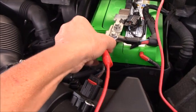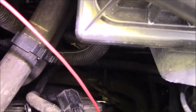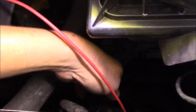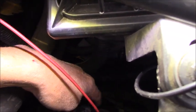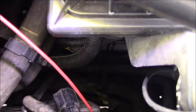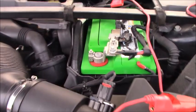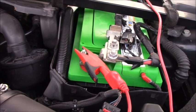See, as you can see, it's running right now. That's it guys — quick test. The radiator fan module has no connection to the engine control module because I left the connector out. I just jumped power directly to the fan control module. Put it in — you can hear in the video the fan is running. That's it guys.